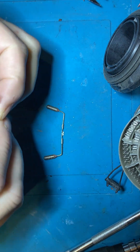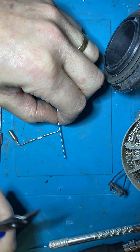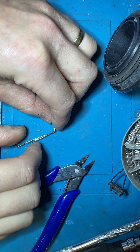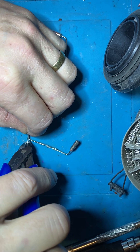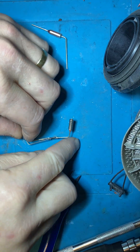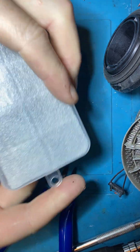So what I'll do then, I'll just get my new thermal fuse. Got the same bend in it, and that'll go in fine. That's your left one. Same with your right one. So that's your new set up there. All I've got now is my connectors.